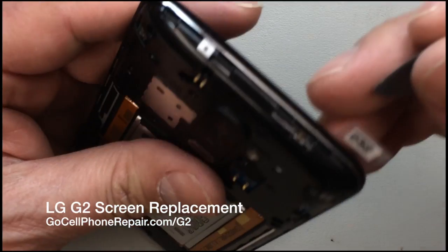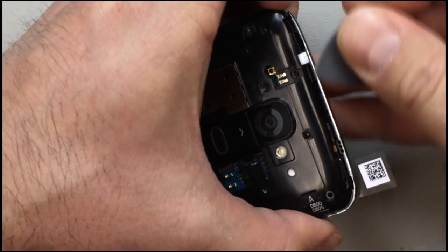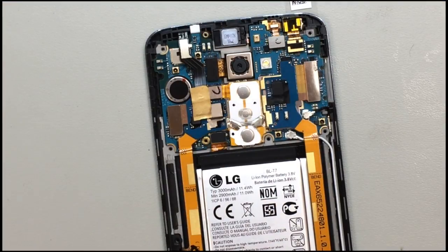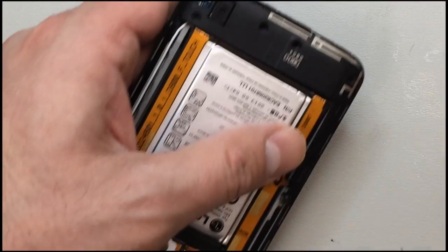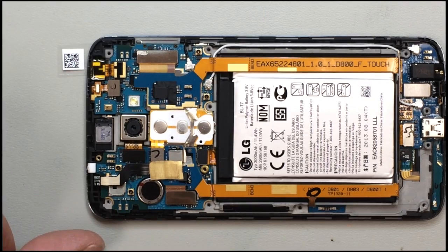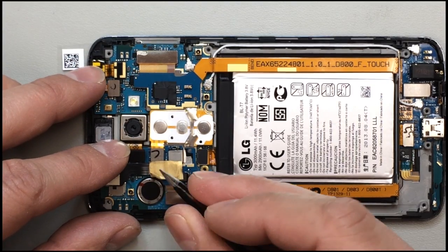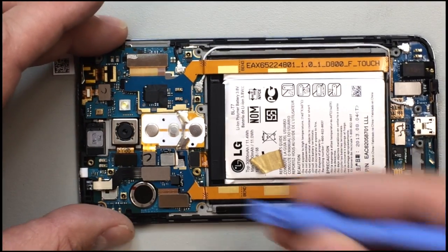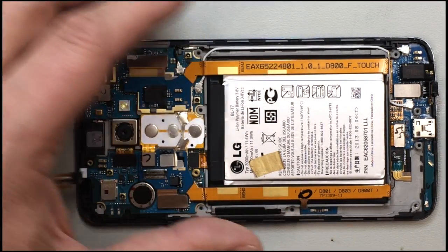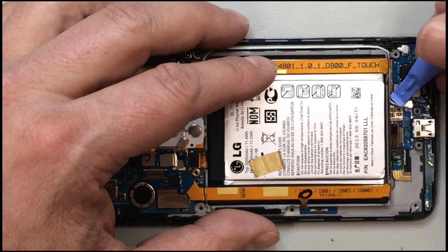Now we're going to pry this little panel off the top end — it also has some clips. Once the screws are all removed it's just a matter of prying from the right areas. Make sure you don't go too deep with your pry tool. Then we have this flex cable assembly that goes up the sides, one little plastic panel on the bottom, and up at the top you've got your flex cables for the display with a little bit of tape over them. I always recommend that you take your replacement unit, plug it in, and test it before full disassembly to make sure the touch screen and replacement LCD are functional. Down at the bottom there are also a couple of pop connectors and an antenna wire that plugs into the secondary board.